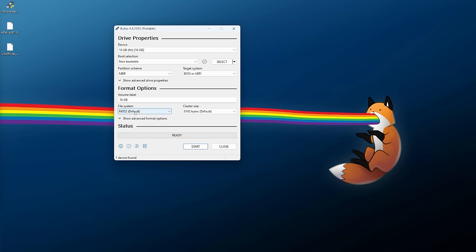With our USB drive set up properly, make sure it's plugged into the PS3. Navigate over to the video tab or music tab and look for your USB device. As long as it's showing up, you've successfully set up your USB drive. Now we need to update the firmware to HFW — you have to do this on any firmware even if you're already on the same version, and it's recommended to do it twice.